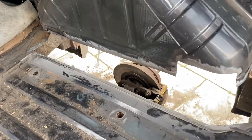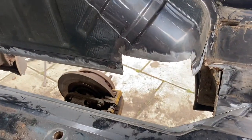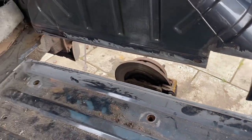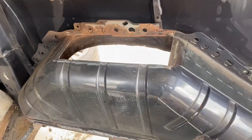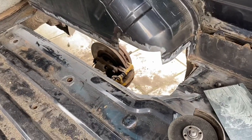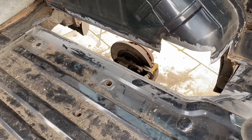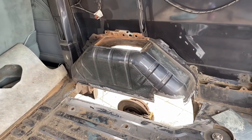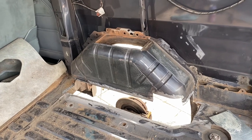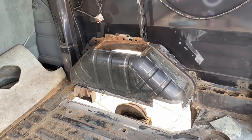Right, okay guys, so that's after we've cut and cleaned up. You've got to clean the metal back to bare metal, as you can see. There's an awful lot been taken out, but that means you just have to put an awful lot back in. That's cleaned both sides, because I'm going to have to weld it double-sided. So that's what she looks like at the moment. I'll just carry on, we'll start tacking and go from there.